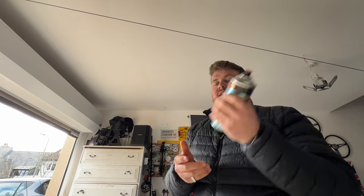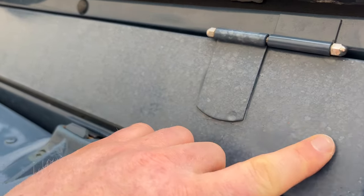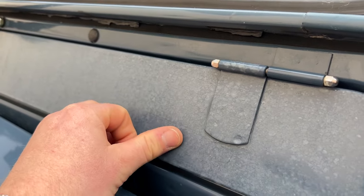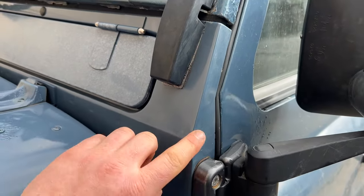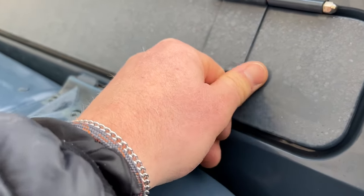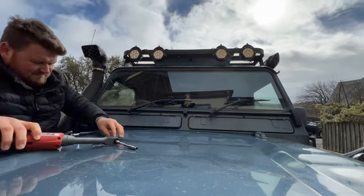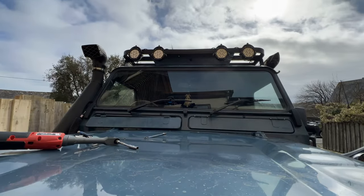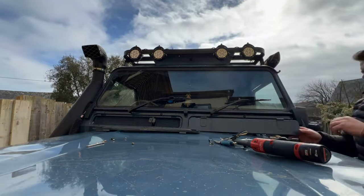With the custom colour and custom fill, they cost about £24 a can, but for me it's worth it because you don't get fading. You can see the difference here between the nice fresh shiny paint and where water got to it — it may not have been fully cured. I think using 2K paint the same as here — done professionally by Jack Fielder using paint from the same company — the aerosol should match. You could potentially polish and re-lacquer it, but I'm happy with the method I'm going for.